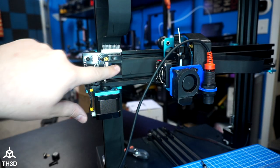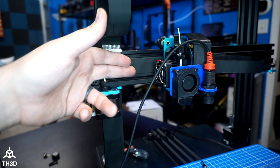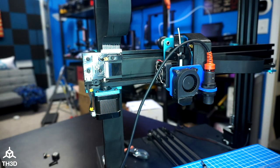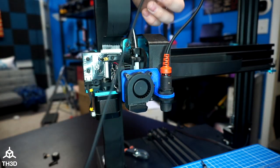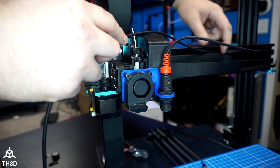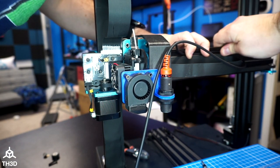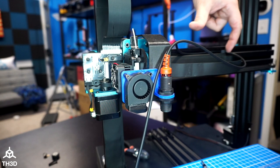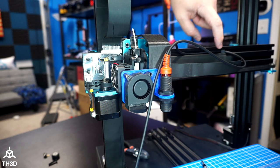Because this printer has ribbon cables instead of a standard wire harness, we have to route this sensor wire a little differently — this is why we have a dedicated video for it. All you have to do is make sure you have enough slack. The wire itself has a natural bend to it. We're going to loop this over and place it into the extrusion where the tape ends on the factory ribbon cable. With the cable in place and the appropriate slack, go ahead and put the clip on — it should be right at the end of where the tape holds the factory ribbon cable. Place another clip about every two and a half to three inches.